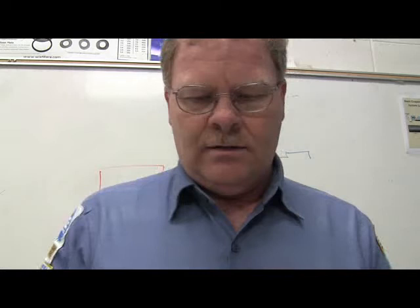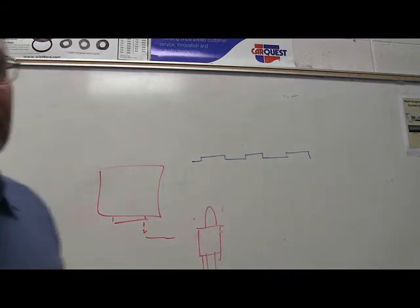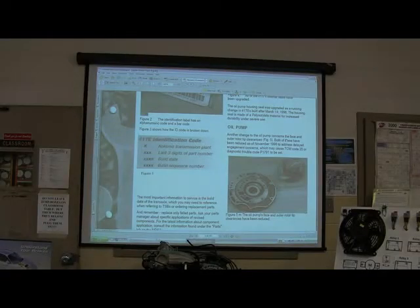And what does it mean when you've got a positive displacement pump? What is a positive displacement pump? That means if that pump is turning, something's going somewhere. Now, what is not a positive displacement pump? A water pump on a car is not a positive displacement pump, because even if everything's stopped up, it can still spin. Well, if you stop up the output on a positive displacement pump, it's not going anywhere, basically. Now, you do have a pressure relief and all that, but just keep that in mind. All right, so there you go on that.